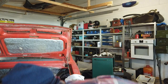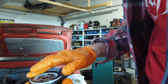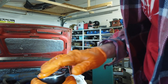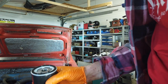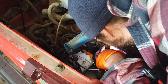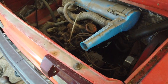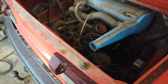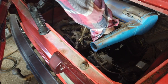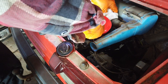And then also remember to lubricate the seal around here to make it seal better. And also having it, there will be a smaller chance for it to get stuck later on. And then I'm gonna go fit the bottom drain plug again. And then let's get some new oil into it.